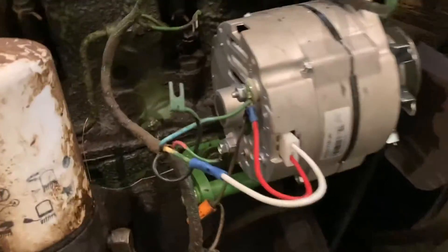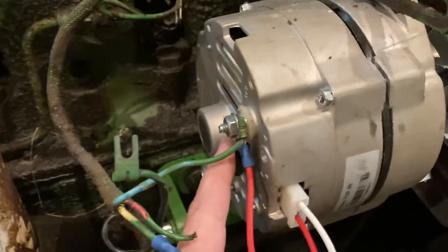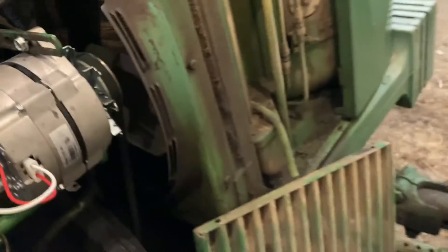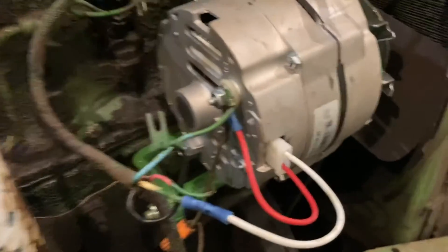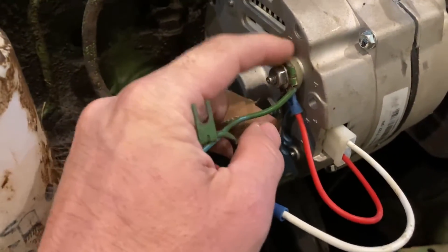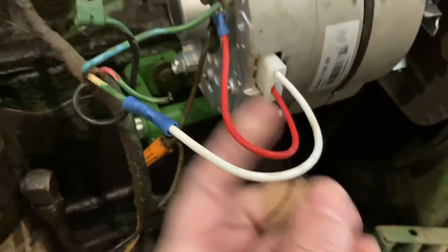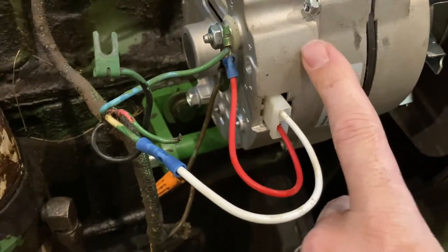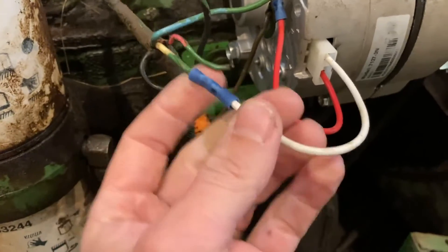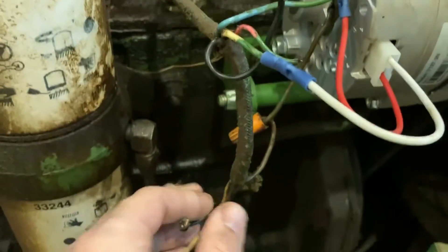This was the blue wire from the harness on the other side and the brown wire — both were going to the original alternator generator that was on here before. These are the power wires from the alternator: the battery terminal wire, and this red wire energizes the alternator to charge. This white wire came from the harness. The other wires won't be used so we'll cut them off and cap them.